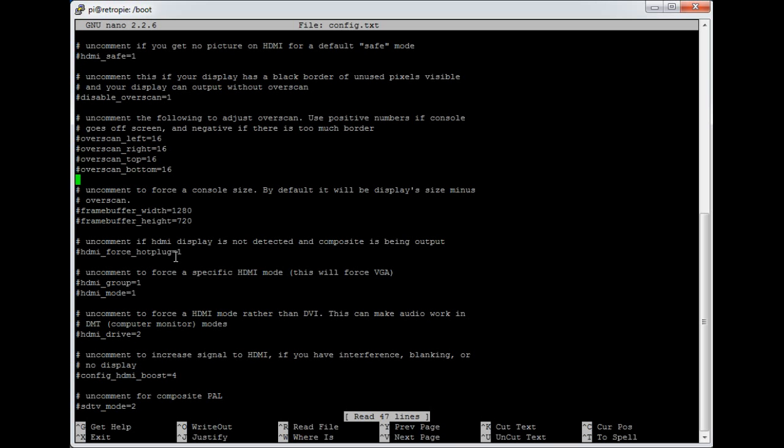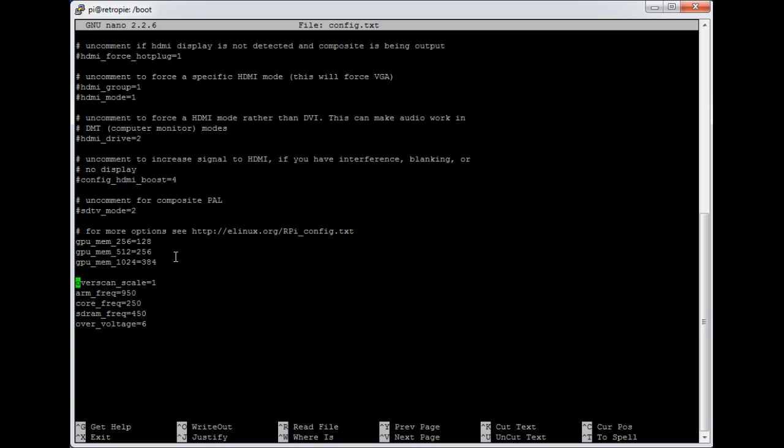here are all the settings in that file, and the ones that we're particularly interested in are where the overclocking settings were, which are right down the bottom here. And you can see I've set it to 950 megahertz. Well, I didn't edit this file, I just let that screen earlier do it, but this is where it appears. So you can read this file if you're not sure it's happened. And similarly, it'll be a little bit different on the Pi 2, where it says this is clocked to 1000 from 900, and the other settings there are being updated as well for you.